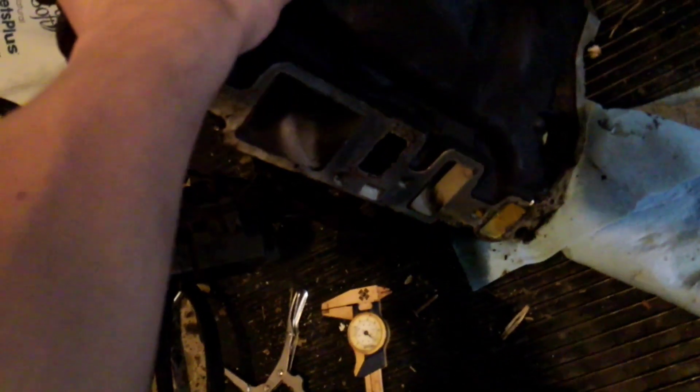Solution: cut it off. I believe it was a drain for coolant, honestly. You can kind of see it runs from these cooling passages up into this guy and circles back around. Not entirely sure why the intake has it, but it's not going to have it once we get this motor back in. We're going to get an oxy torch, cut this off, and then tap this plug — I think it's a half-inch pipe plug — two or three threads farther into the intake so that it's flush and we can mount the intake. That's the big difference when going from the non-balance shaft to the balance shaft.